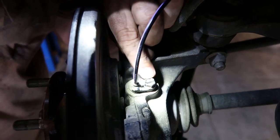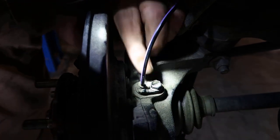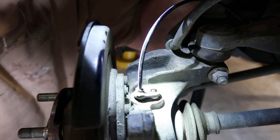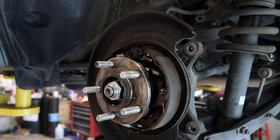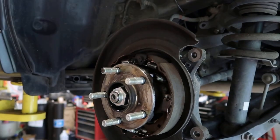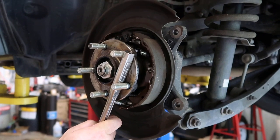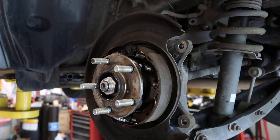This is your wheel speed sensor right here. This is gonna be a 10 millimeter bolt — you're gonna take this out before you take your hub assembly loose, because if not you can damage this sensor. I'm just gonna take the pliers and squeeze it and that'll come right loose there. Take this nut off — you need a 32 millimeter axle socket like this. Now if you don't have an air gun, what you need to do before you take your rotor off is set your parking brake and break it loose with a break bar. The other thing you can do is take a pry bar and put it in between the studs and hold it and just break it loose that way. Since I've got an air gun, we're gonna go ahead and take it off.